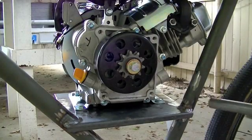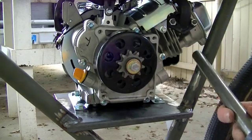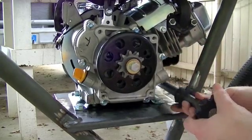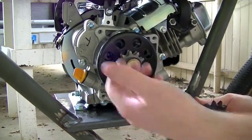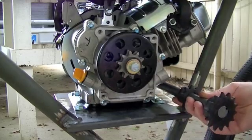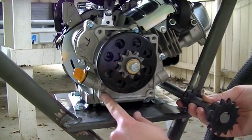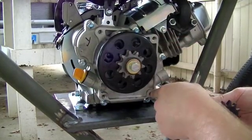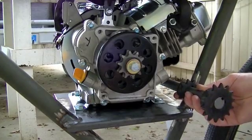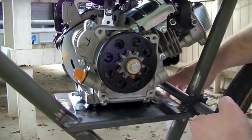Here's the basic idea. I got the jackshaft kit here — effectively, it's going to ride in here just underneath the cylinder head, and the engine will be shifted over towards the center. I'm going to make at least one of the bearing retainer brackets utilizing the engine casing. There are four threaded holes, and I'm going to use those to hold one of the bearing retainers. The other one I still haven't quite figured out — it'll probably be mounted on the back of the engine plate.